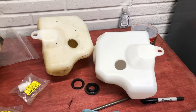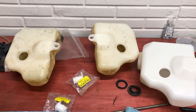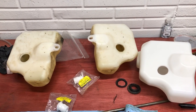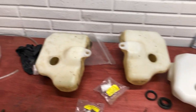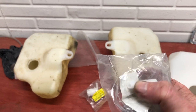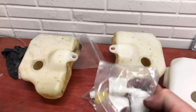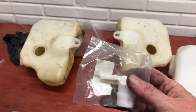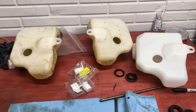This one is on the right-hand side — I've still got to take the protective covering off. If you've not done anything with your fuel evaporation tanks, it's one of those out-of-sight, out-of-mind items. From what I understand, the original float valve piece that goes onto the evaporation tube is prone to break if you try to install it, so it's a good idea to go ahead and get new valves rather than risking breaking yours. Alright, that's it — on to the next one.